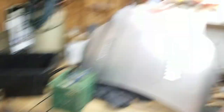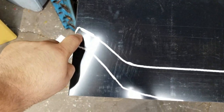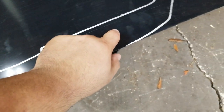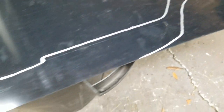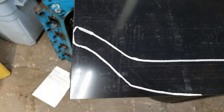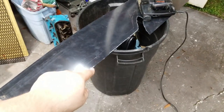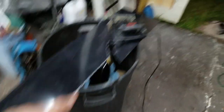Alright, so once the cardboard cutout was checked, I went ahead and modified the mounts on the top — just pointed them a little bit more to fit the body lines of the car — and then traced it out on the ABS. I can't remember what size this was at the moment but it's a thicker size. I'll go ahead and cut this out probably with a jigsaw. Using the jigsaw — I didn't quite have the right blade, that was the wood blade; I was hoping to use more of a metal blade for a smoother cut — but it worked, got the whole piece cut out and it's now on the car.